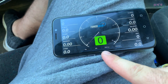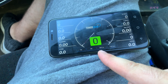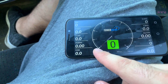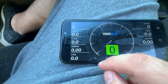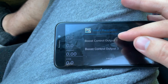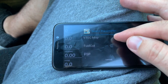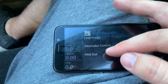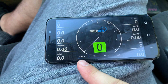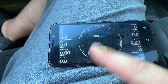In setting this up, I've already done the ignition cut and the fan. That will tell me when the ignition cut happens — if I'm in a two-step or at the top of the rev limit — and when the fan cuts on and off, which is good to know. The MIL is the check engine light. If you hold down on a gauge, it says select the parameter, and it will show you any of these. What I want to have is my VTEC — when the VTEC solenoid goes out, this is your VTEC output. I'm going to select that. As soon as the output for the VTEC comes on, it automatically shows up a light. Mine's set at 4,800 RPM, so it would automatically come on and you'd see the VTEC light.